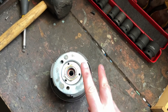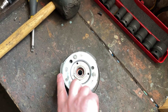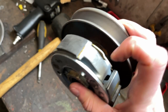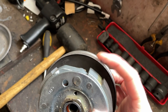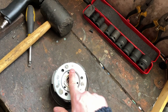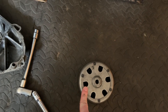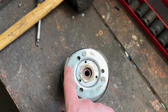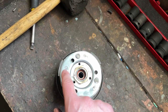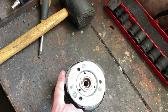Your clutch usually has two, but mostly three arms. You can see the arms here — they've got a pivot point at the end of the arm, and then you've got the pads here. What happens is as this spins round, the force of it spinning flings these arms out and they contact the inside of the bell here, which basically engages drive. The springs here dictate how fast these arms fling out and engage the drive.